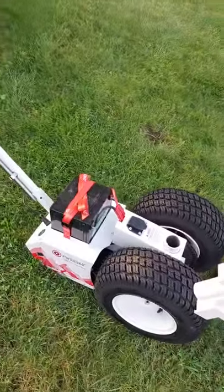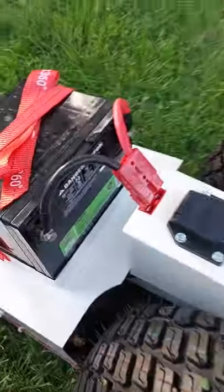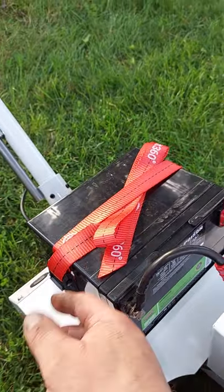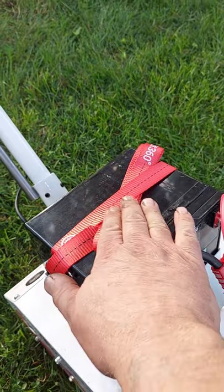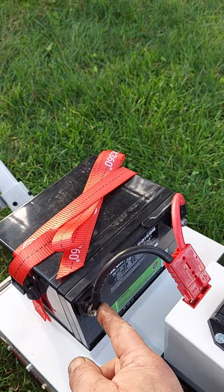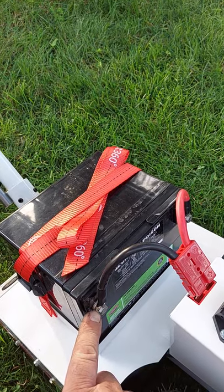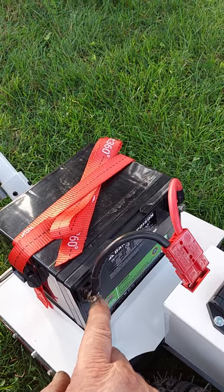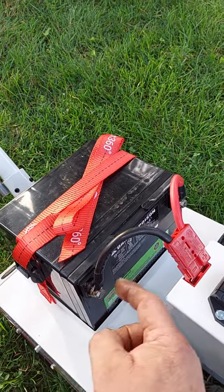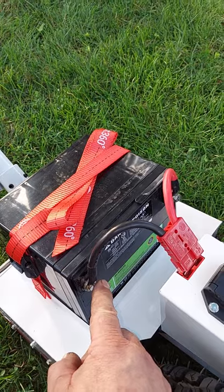Here's the unit. The assembly was pretty straightforward. You set the battery on — you put the negative on this side and the positive on this side — and you strap it down. The strap is very long; I just tucked it up underneath. You'll need the 10mm socket for the battery bolts. You put one washer, which is the split washer, underneath the bolt first, then you put the lead on, then there's a flat washer that you put behind the lead, and then you hook that to the battery terminal.